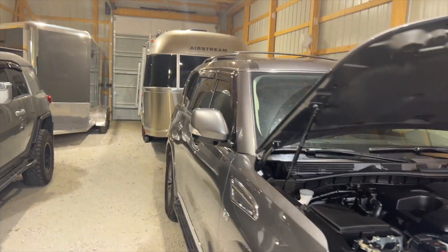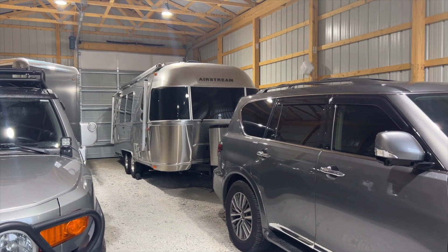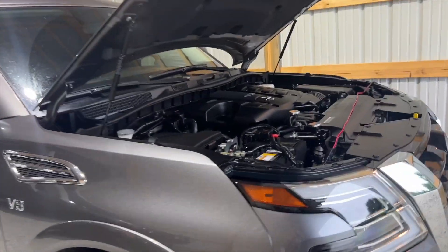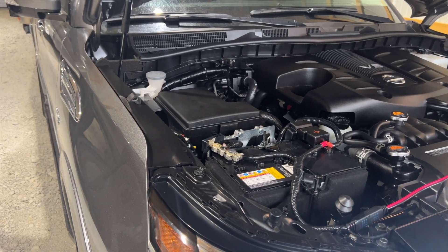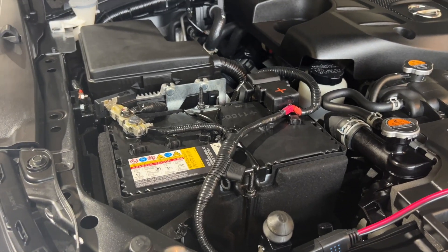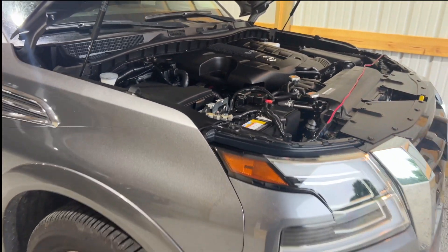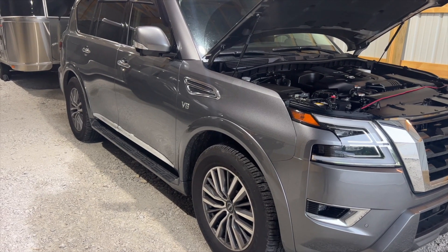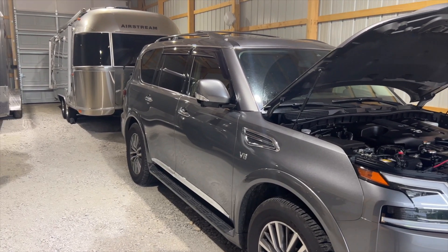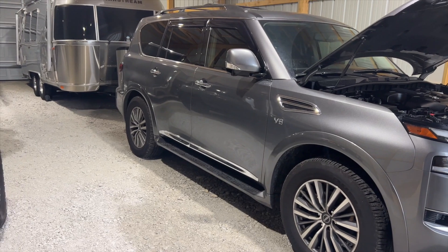This is more of a going-down-the-road overnight solution - no sun, dark, solar panels not charging on the trailer. We're going to add two more 270-watt panels - you'll see that in a future video - but right now we just have the 190-watt panel and that does no good going down the road. The 17-amp charger is smart - it shuts down when the truck's not running with auto-detect. There are a lot of videos out there to learn more about how these work.